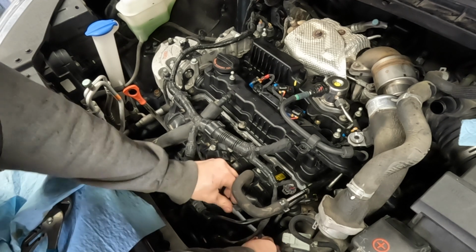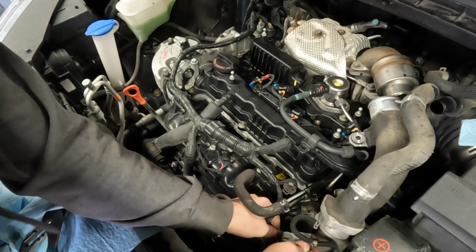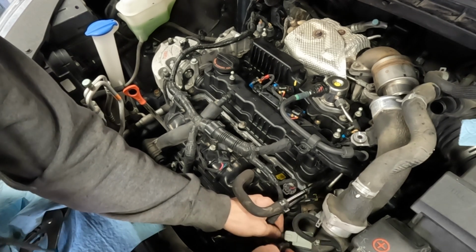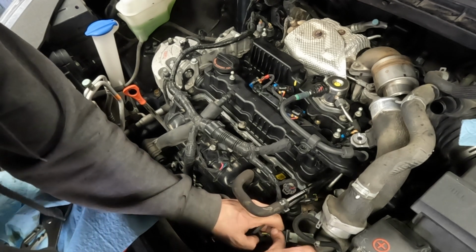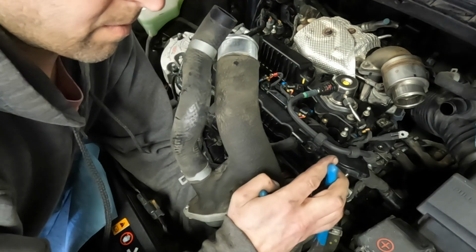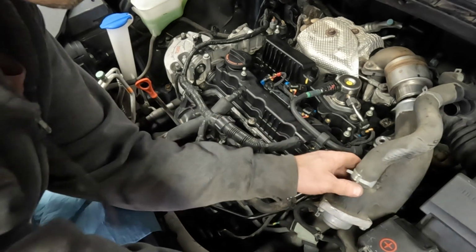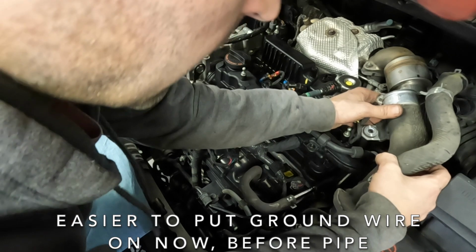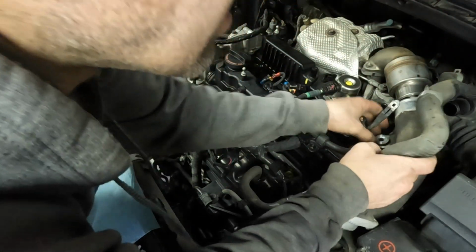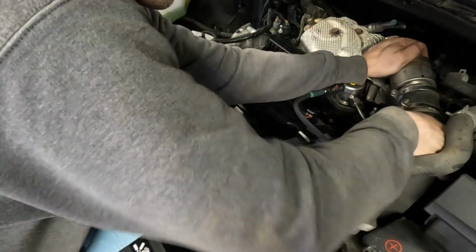So this hose snaps into the intake manifold and pushes into the back of this, whatever this is, solenoid, some sort of valve. Oh, it's some sort of boost control, bypass or blow off. The wire clicks on here, this connector clicks on there rather. All right, I've got that hose clamp back on. That was way more silly than it should have been, but they used those stupid hose clamps, and so yeah, it was a little bit miserable. There we go.